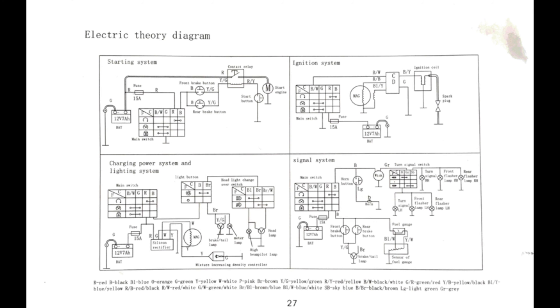Page 27 is the wiring diagram — this is actually very useful. There are two main types of systems: some scooters use a DC CDI and others use AC. If your headlight turns on with the ignition switch, you have a DC CDI. If the headlight only works when your engine is running, you have an AC CDI. The magneto charges the battery and generates alternating current (AC), which then goes to a rectifier that turns it into direct current (DC). DC is required to charge the battery and make the electrical system work. On some scooters, some of that AC power goes directly to the ignition module, CDI, and the headlight. If you do a Google image search for a GY6 diagram, you can find a wiring diagram for your scooter.